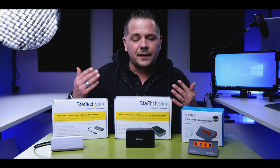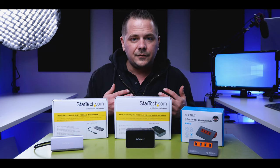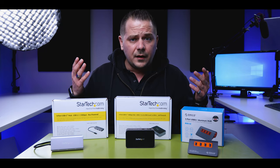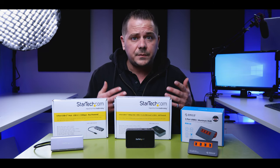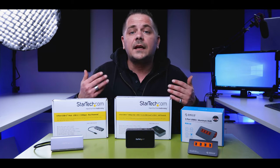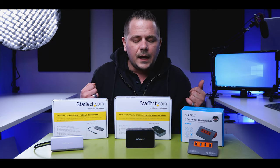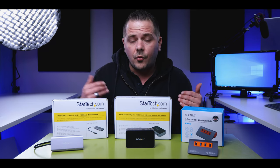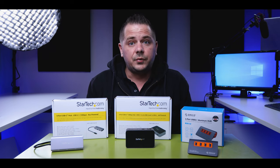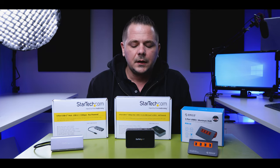So why wouldn't you want to get one of those Thunderbolt 3 hubs? Well, they're not up to par yet with the ports. Yes, you'll have the Thunderbolt 3 connectors and you can connect your monitors, but you only have one or two on there, and the rest are like USB 3.0. So let's break down the classification. You really want to have at least a few ports that are USB 3.1 Gen 2. Gen 2 is 10 gigabits per second. That will bring you up to around 780 to 800 megabytes per second transfer rates.